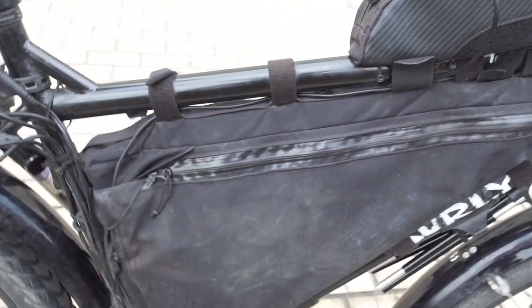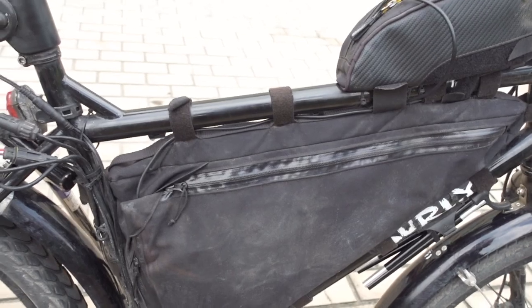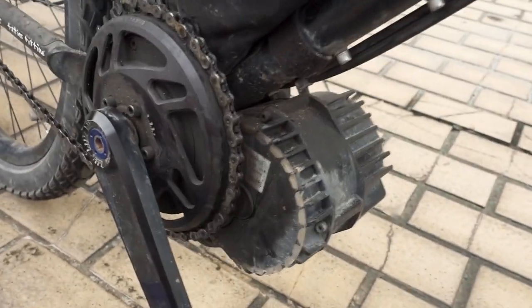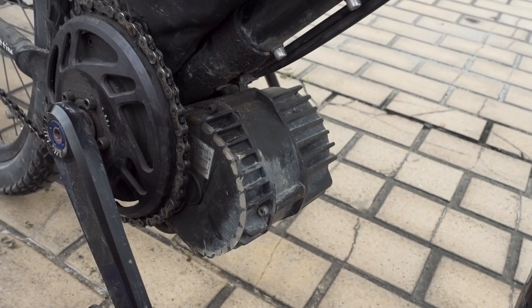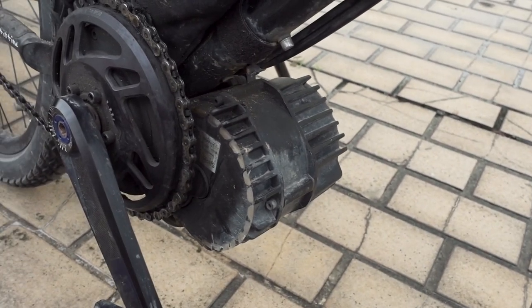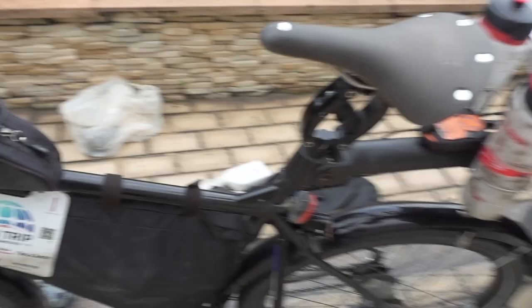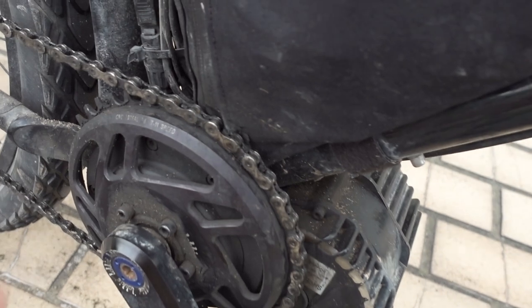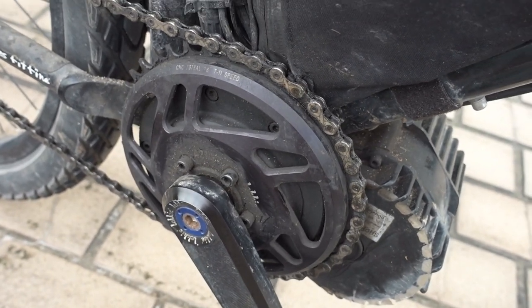There's no problems with any of the electrical stuff, which is really good — it's quite a rats nest of wiring in there though. Moving down to the motor: the BBS HD. A lot of people know this very common mid-drive conversion motor and I've had absolutely zero problems with it. I've done over 12,000 kilometres on a previous one when I was a cycle courier and now over 13,000 kilometres on this one. The one thing you absolutely must do is open it up when you get it — it's really easy to do — and take the chain ring off.